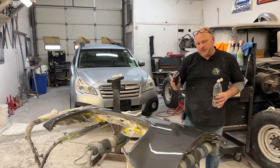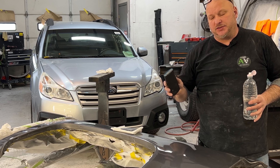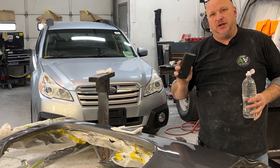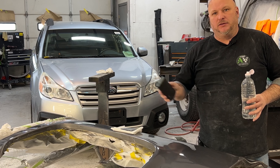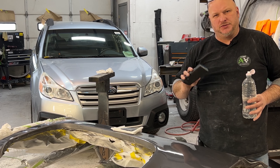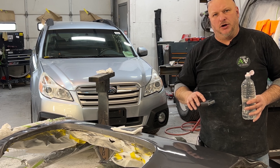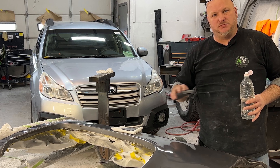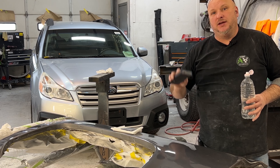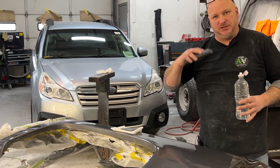As I begin, one of the disclaimers is we're starting off with 600 grit wet sandpaper — very, very aggressive. The reason I say do not try this on your regular vehicles is because you will sand through without a doubt. The clear coats on most new cars are not high solids — they're a very thin clear coat, made to go on thin, flat, and look nice but without buildup.